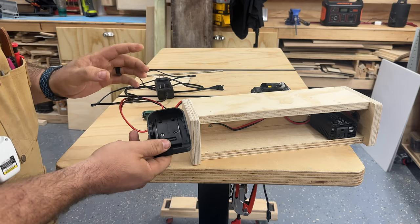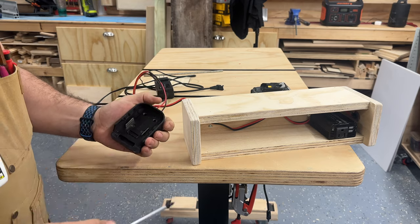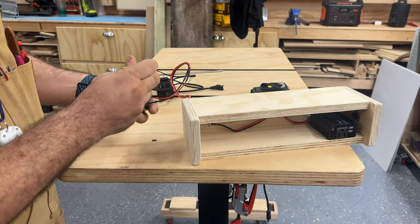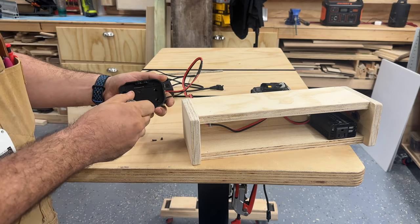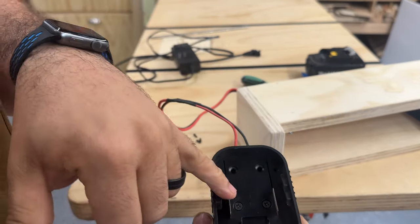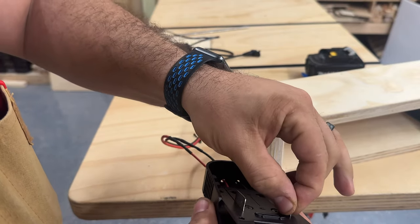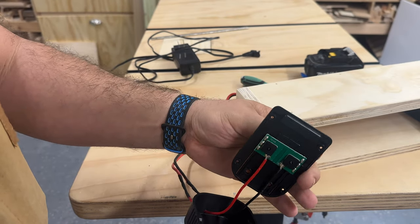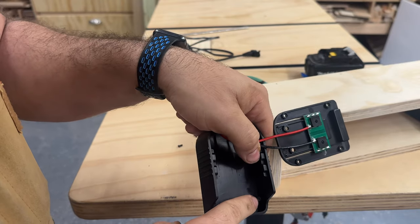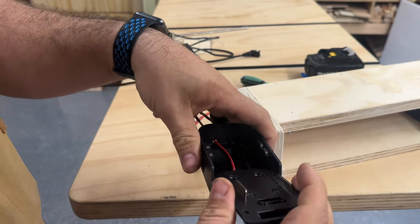When we're talking about the battery holder, that's a different story. You don't want to just glue this — I'd like to be able to remove it. So what you need to do is take it apart because you don't want to willy nilly screw into an electrical component — there might be a circuit board in there. I want to point out that you can see where it says M and B where this blade is — it's in the Makita or Bosch position. They're very similar batteries, so this one unit can be used for Makita or Bosch. There's a circuit board on this piece. My goal was that I could screw in here and still put this on, and that goal is obtainable because you can see these posts — as long as the screw heads are beneath this post, I can just put this right back on.